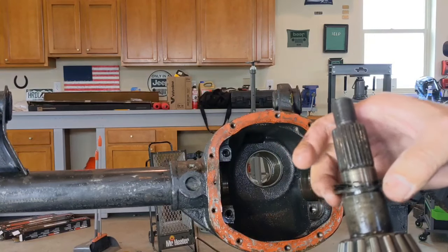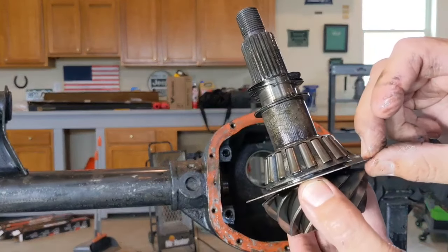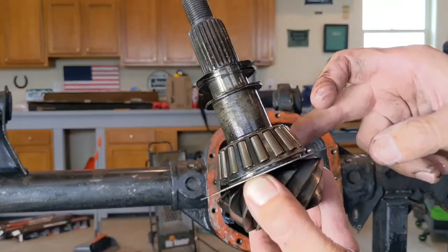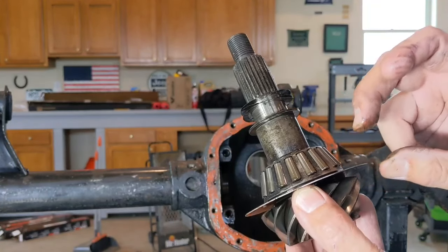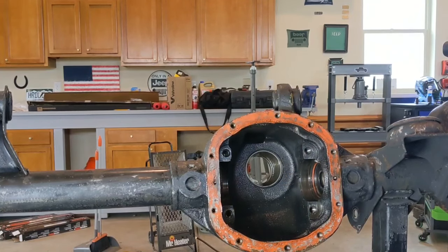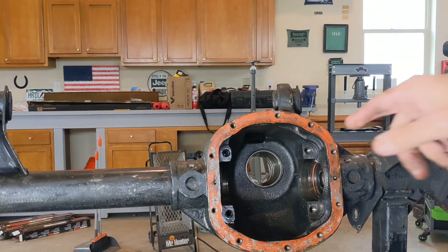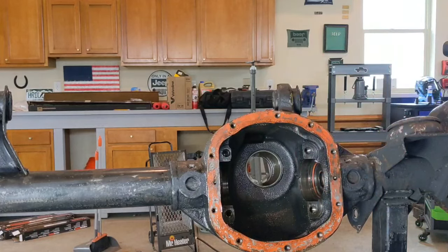As you pull the pinion out, you'll see your tail bearing shims — those set the preload for the tail bearing. Right here you have a slinger that's also a shim, and that sets your pinion depth. We're going to get rid of this and put shims behind the pinion bearing to give us our pinion depth. These aren't absolutely required — they use it as a shim and to help keep gear oil on the pinion. If you think about it: if you filled this housing with gear oil, had your ring gear spinning at speed, you'd find gear oil all over the ceiling. So getting that slinger in there isn't that critical.